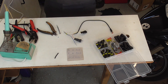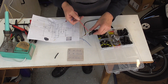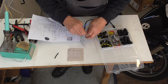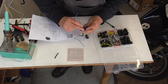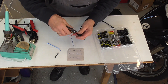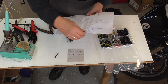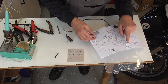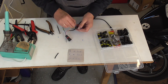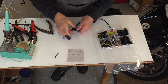Okay guys, and now this is my drawing. This comes straight from the battery — red — and that comes over here with a red tie wrap here. And the yellow one is after I put it on ignition — that relay comes in, relay three — and that's the one that's blue. Blue must be the color. Check it there.